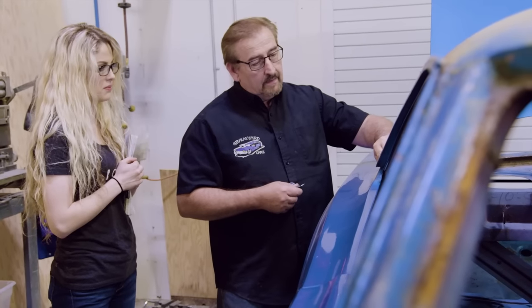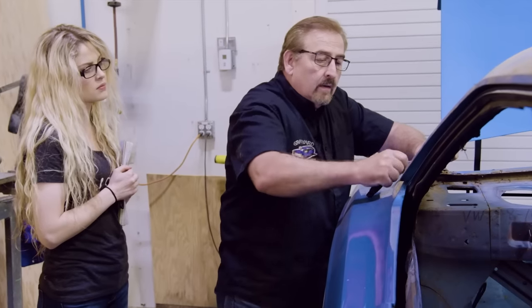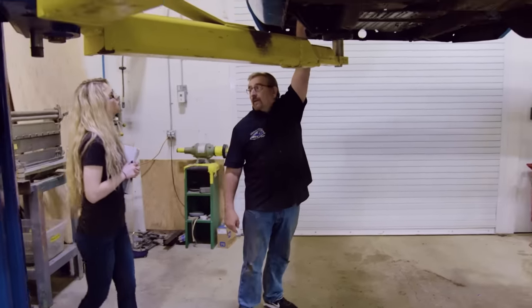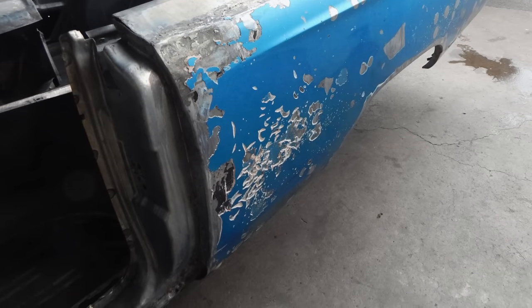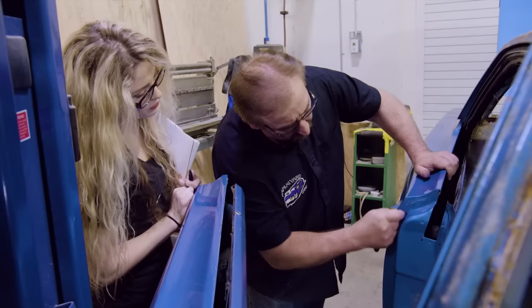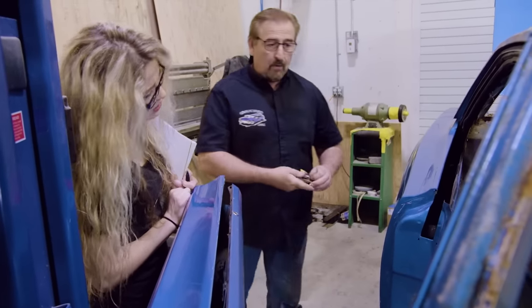Not just a bad paint problem — it usually starts way down low. So the Bondo filler they used on the roof came up through and was beginning to bubble through the paint. I've learned a lot over the years working with my dad. I found this build really interesting because it shows you how much damage and rust you can hide under filler and paint. Even the door jams on this car were filled with Bondo — they were sculptured. It looked like they had sculpted in what would be the quarter seam, but there was no quarter seam; it was just made out of filler. Kudos to the guy that did the filler work. You have a job at Graveyard Cars if you ever need one — just start with better metal.